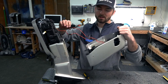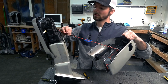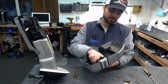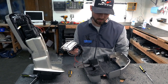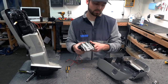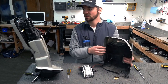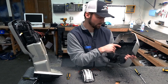Again, this one has switchback strips in it. Obviously, a factory mirror, you won't have that. It'll just be this part of the mirror here. So once you get that back plate off, this mirror light should just pop out right like that. And then you have access to either switching this out or just replacing a broken one, whatever it may be. And then, if you're switching mirror caps, this is also a nice way to do the mirror caps if you don't want to end up breaking.